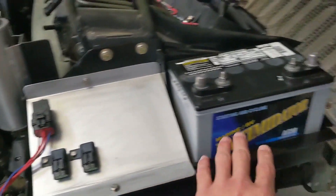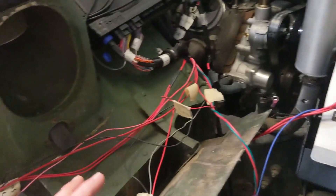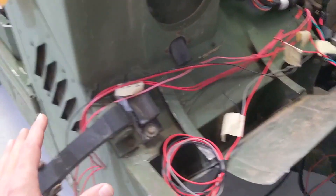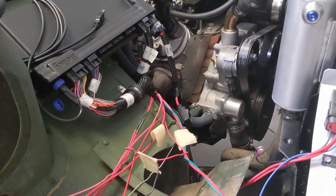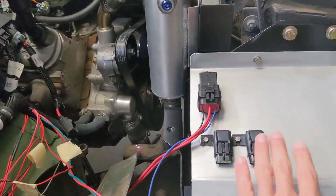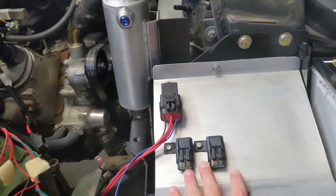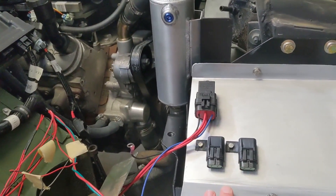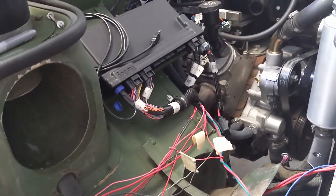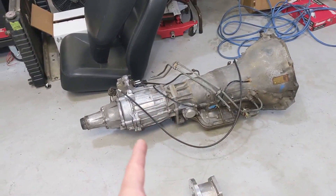It'll be easy to access the fuses and the relay, and I've got tons more space if I need to add anything else. I've still got the front battery for the 12-volt system. I've cut all the wiring back because I'm going to shorten the wires — Holley gives you plenty of wire expecting you to route it all over. I'm going to put the air box in, run the wires where they need to be, and for the most part the Holley system wiring will be done — except for the transmission.